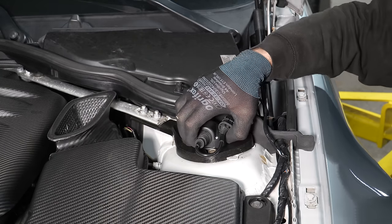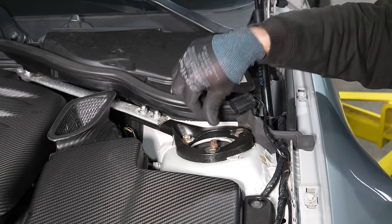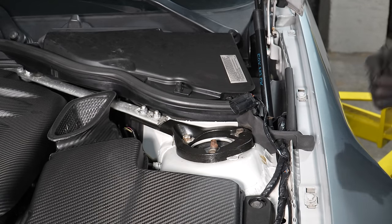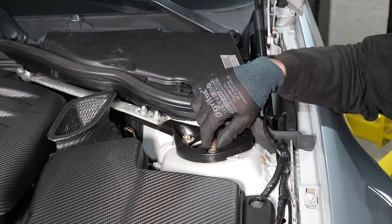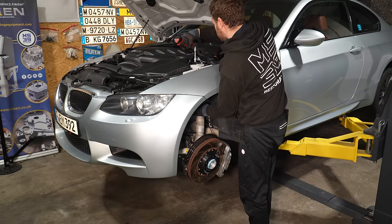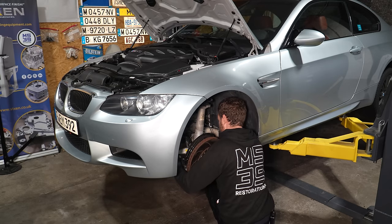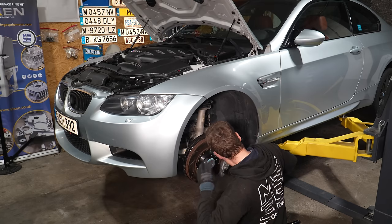This EDC connector I already disconnected in an attempt to stop the computer from switching the EDC shocks into the stiffest setting because the front valves in the shocks failed and then it automatically kicks them into the stiffest setting. And it is unbearable to drive, so, so uncomfortable. Don't forget to remove the little sway bar for the headlight level sensor. Great, now I have salt in my ear.